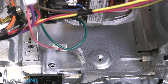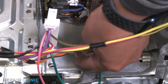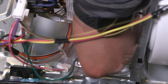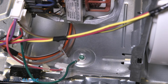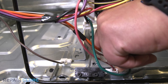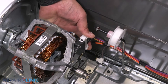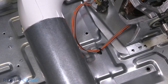Set the wire harness in the retaining clip. Re-thread the ground screw. Plug in the dryer belt switch. Plug the harness into the motor. Re-thread the connector. Make sure the idler arm is able to operate the switch. Snap in the retaining clip.